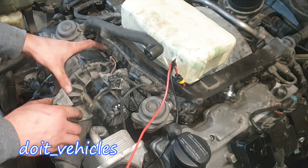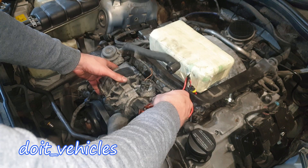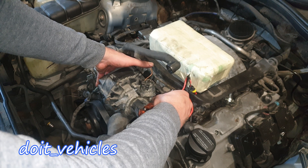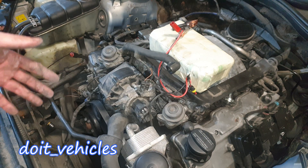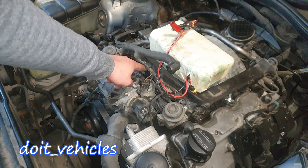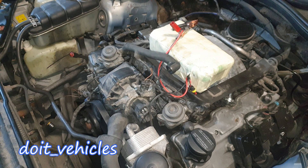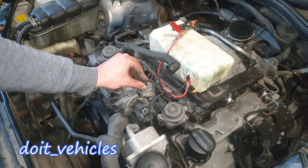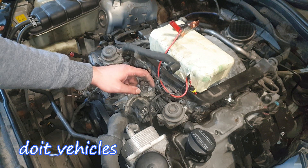I've got a bigger 12V battery here and I've got the pump. Let's put it back in position and apply 12V to it. The air pump works. If it makes a lot of winding noise it's most likely not delivering air pressure, but on this one there was a lot of pressure and the sound was normal — everything looks good here. One more thing to check when you start the car for the first time is to verify you've got 12V being sent from the computer.